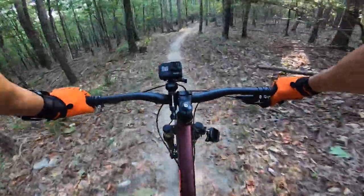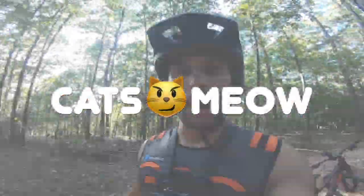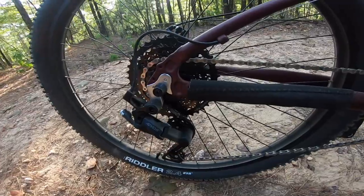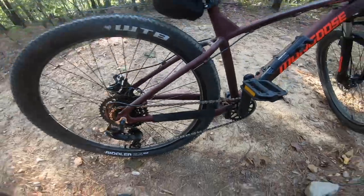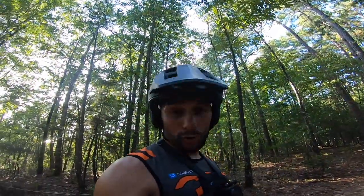You know it's weird because you don't hear a whole bunch about Micro Shift stuff - you constantly hear about SRAM or you hear Shimano. We have the Micro Shift Acolyte 8-speed on the GT - great clutched/chain-stabilized group set. Now the Micro Shift Advent 9 - this is the first 9-speed bike we've had on this channel. Guys, it is butter back there. I'm shifting without letting off the pedals - putting tension on it and it's shifting no problem. I'm in second gear and the 11 to 42 tooth is going to be such a nice change as far as climbing - beats that 34 to 38. Let's go ahead and get you guys to the top of the Cat's Meow.